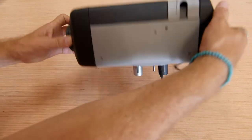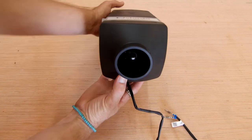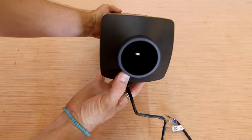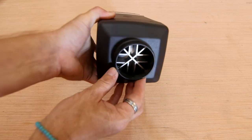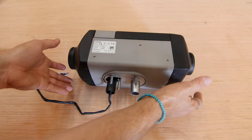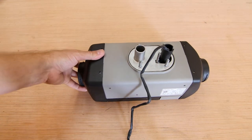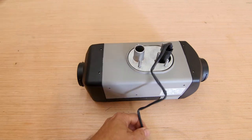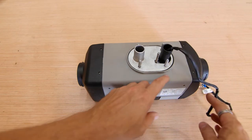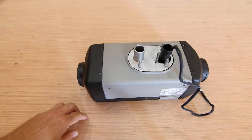Here's the heater itself — it comes packaged in its own box. It's a tiny little thing, perfect for a compact space like a van. On one side you have the air inlet where cabin air is sucked in, heated by the heater, and then on the other side the hot air goes out. Both inlets and outlets use 60-millimeter ducting and vents. On the bottom there's the combustion air inlet — the plastic one — with wires coming out for the fuel pump.